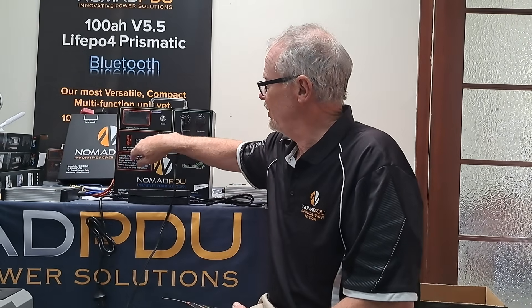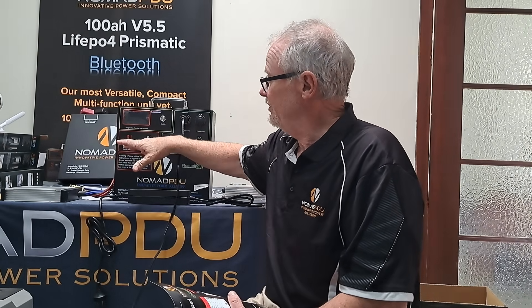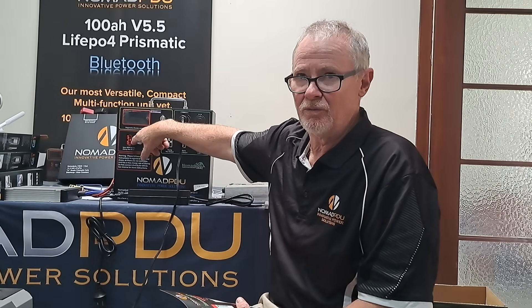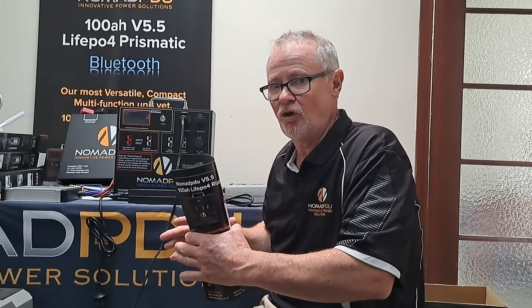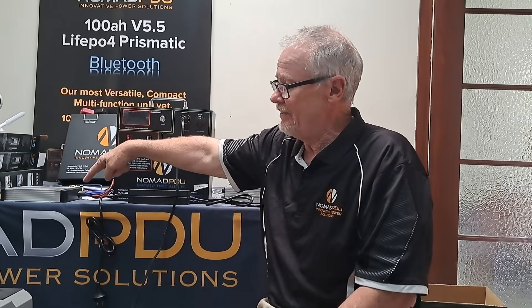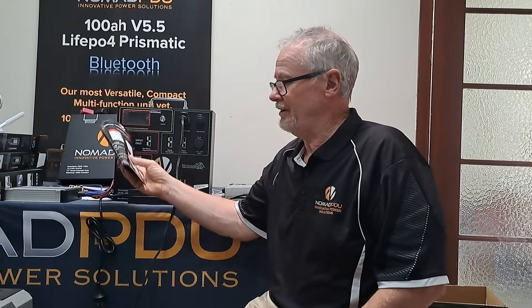Think about: how quickly can you charge it, what are you drawing out of it, if it's full every night how does it draw overnight, and what are you charging by DC-DC versus solar? If you've got a regulated 600–700 watt solar panel at 50 amps for five or six sunshine hours a day, that's 250 amp hours going in. That'll be full every night. You can also have a DC-DC and a solar panel connected at the same time through the MPPT, as the 50 amp max charge rate accommodates both. And you've always got the direct solar connection as a handy backup if the DC-DC fails.